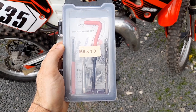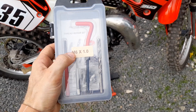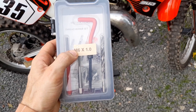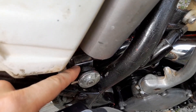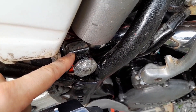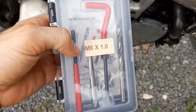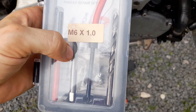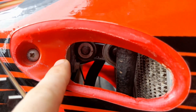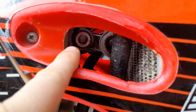The next renovation technique is to have an M6 thread cutter set, which costs around ten dollars. With it you can fix a lot of broken threads on the bike — for example, the threading for the exhaust mount was broken, so you drill it out and install a new thread. I also used it on the gas tank mounting bolts on both sides, which had destroyed threads and are now good as new.